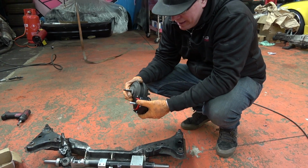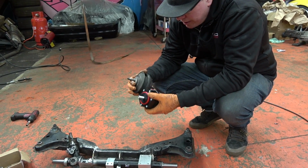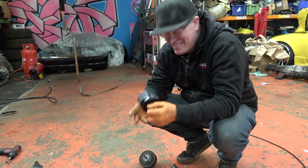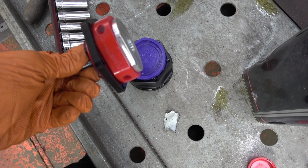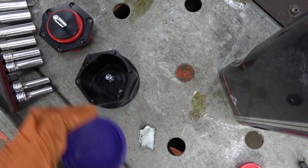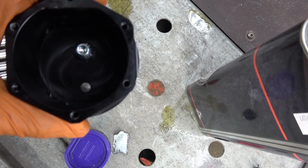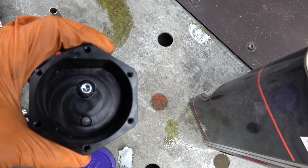Yeah, because height it needs spacing up a bit, but that shouldn't be too difficult. But yeah, I guess just take that apart, see what's going on the inside. Okey-dokey. Try not to break it. I'll do my best. So inside this nice thing is, well, that's the top piece. Remove the bottom part and it's just a bolt straight through the bottom, tapped into it, so we can definitely re-tap that in the centre and save ourselves quite a lot of work.